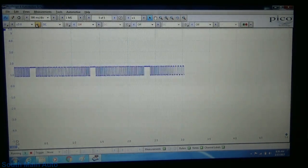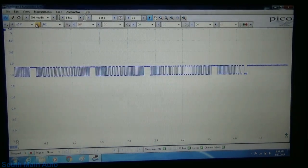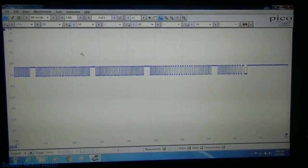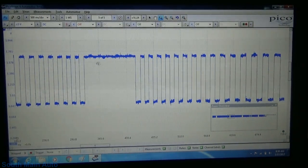So that's turning it good and steady. We can see the obvious problem back here — our problem is not the speed sensor. We've got this big giant gap where the signal stays high, and I'm going to show you why. We can have a look at this tone ring.